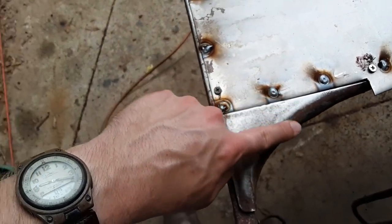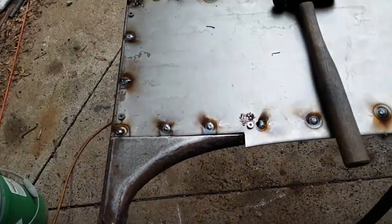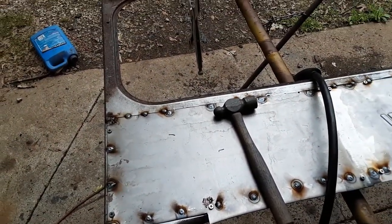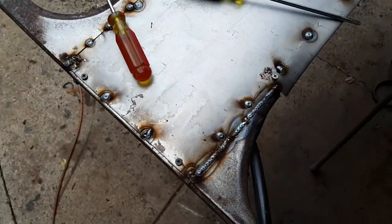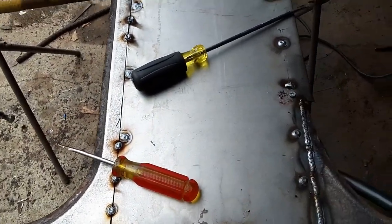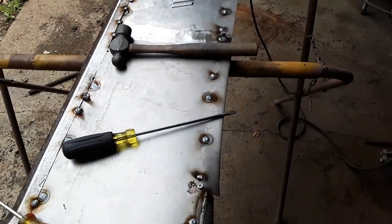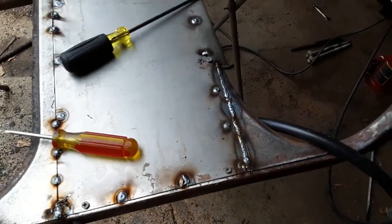Now I've got to do the fun part — not really looking forward to it because it's like a drop-off. So I'm going to have to twist and tweak that, then I've got to roll this edge all the way across and weld it on the back side. Got one side done — wasn't too difficult. I basically used two flat-head screwdrivers and worked it, tacked it, and finally got it. Had to use the hammer too.